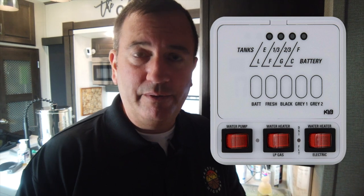You may see this display behind me and wonder what this is. This is our LCI 1 control panel in our Grand Design 397TH. This panel controls all of our systems including showing us the water levels. I thought I would start here because one of the very important things you need to keep in mind when managing your black water tanks especially is it needs to have ample water in it to break down the solid waste. We want to make sure the black water tanks fill up to at least two-thirds full before we dump them to give time for the solid waste to break down. To check that you go inside to your monitoring panel — yours may look like this, or have the type where you push a button and it shows LEDs for one-third, two-thirds, and full.